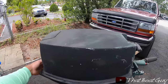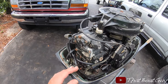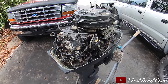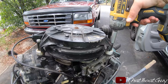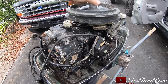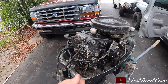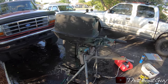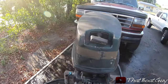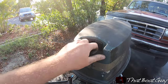We're going to move on to this engine — it looks like it's locked up too. I just realized the coils are missing and the spark plugs are already removed. I'm going to tilt the engine, spray some penetrant in there, and see if we can unfreeze it. My camera wasn't recording, but as you can see it's freed up. Looks like we just need some spark plugs and coils — maybe this motor will be a good runner. Got the carb on, the motor started on the third pull. This was a locked-up motor — and it started first pull!